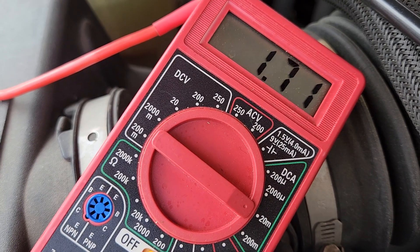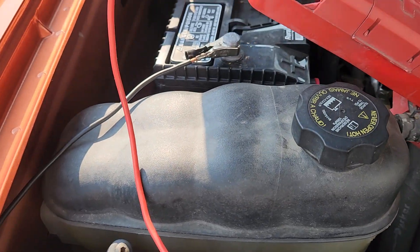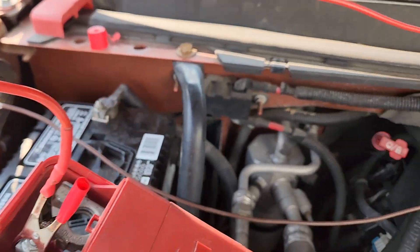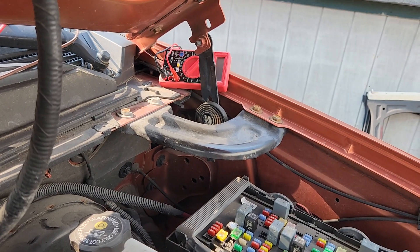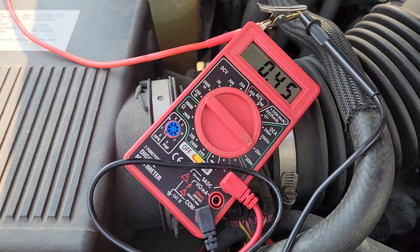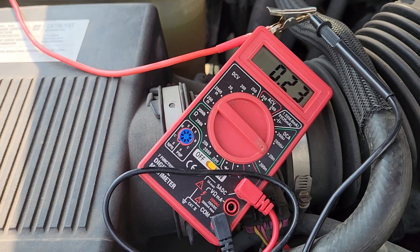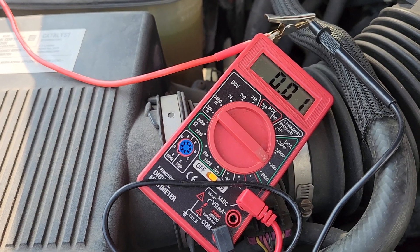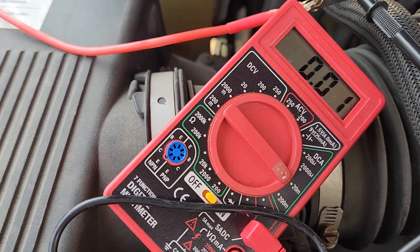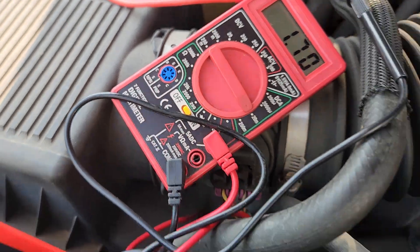That's a lot. I've got this ammeter running in series — I've done it on the negative and positive. Don't pay any mind to this other wire; it's not hooked up to anything relevant now. Usually it's something that's a dead draw off of one circuit, but this is just cycling up and down like something's constantly asking for information — seeing it go completely to zero, or like 0.01, then jump clean up to the 170s.